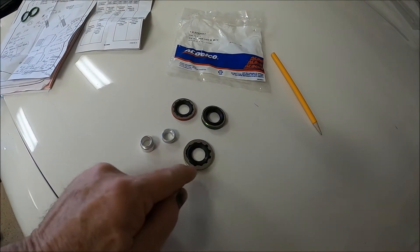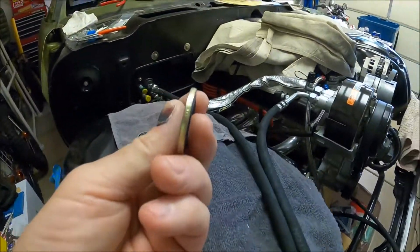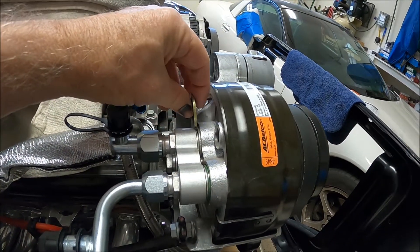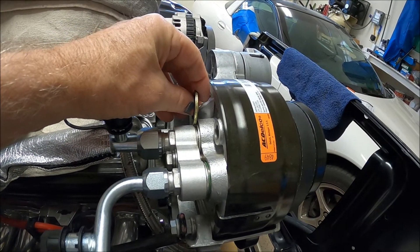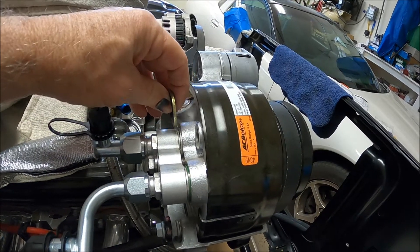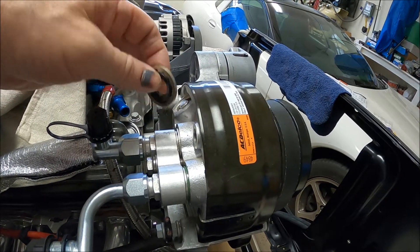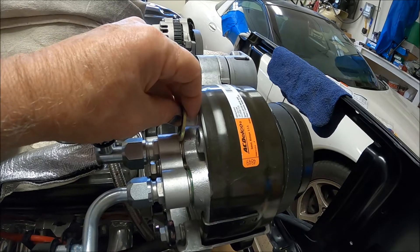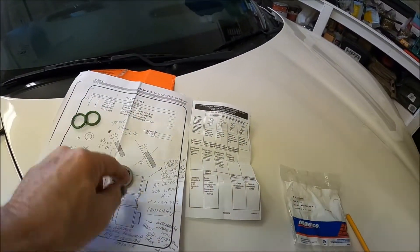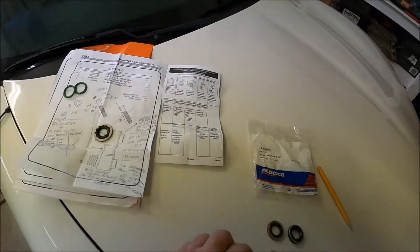This one has the larger OD, so this is your suction washer. You don't really have much choice about where this goes — it goes on the suction side, obviously. It sandwiches in there in a slight recess; it almost sits flat but there's a slight recess right there. So that's your suction side. You don't have any choice about where that goes. We'll put this suction washer on the suction side of the adapter block — the Vintage Air adapter block.